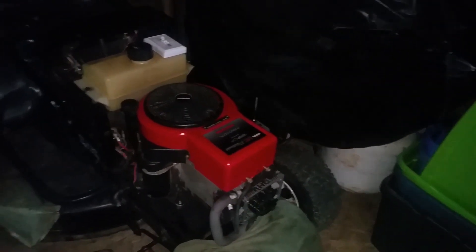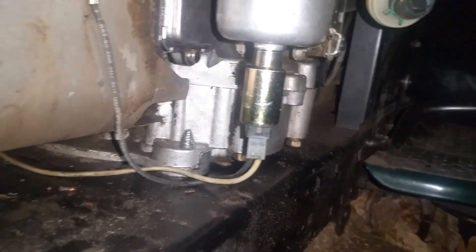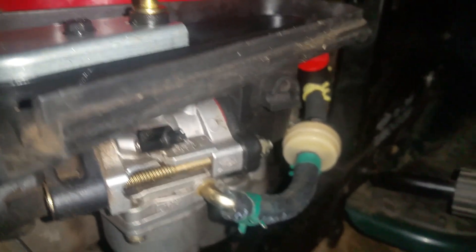I had him clean the fuel shutoff solenoid. On the bottom of the carburetor there's a fuel shutoff solenoid on these — that gold color item. That was working okay; it was popping up and down every time we turned the key off and on. So that's working properly. We also checked the flow through the fuel line and through the tank, and that was flowing real good.